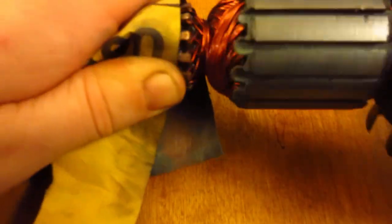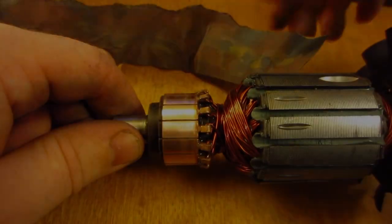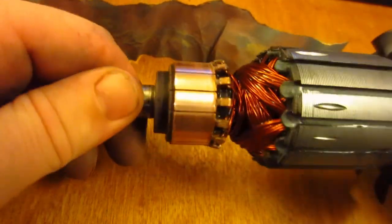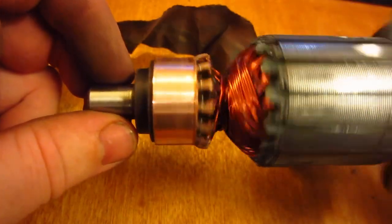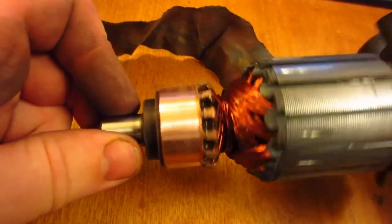You can start off with a rougher sandpaper than 1,000 grit. Make sure you remove all the scratches before you put the thing back in. And there you go — for just a few cents of sandpaper, the contacts look brand new. I'm pretty psyched about this. Get it back together and see how she turns.